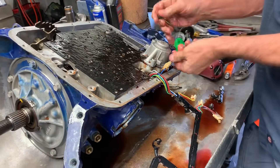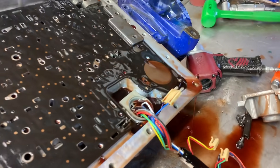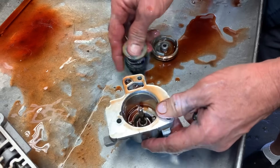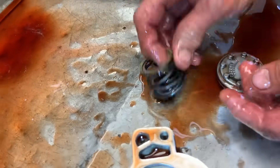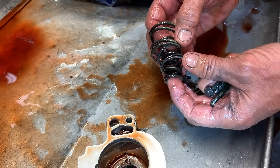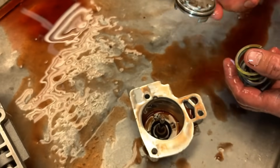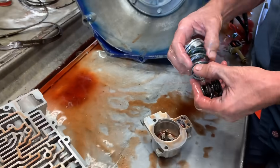This here is your 1-2 accumulator. This actually softens the second gear shift. What they do is use different spring tensions on this piston to control how the band comes on, and they put fluid behind it to push down and control it. This does have a shift kit because it's got multiple springs in here — normally there's usually two, or sometimes none from the factory. We'll come in here and stand some shims up on top of this to shorten the stroke of this piston. Instead of letting it do a full inch and a quarter or inch and three quarter stroke, we'll shorten it down to about an inch. That way it applies the band a lot quicker.